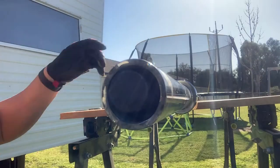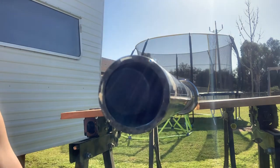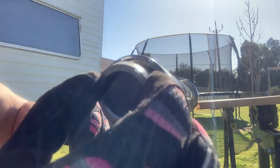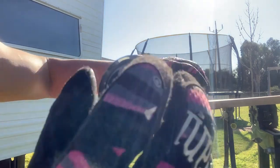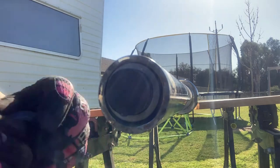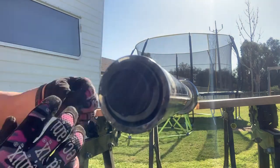Step ten: slide the sleeve back onto the bar and give it a little spin to lubricate it. The next steps are just to put everything back together in reverse order — that's why it's important to lay everything out in line. Some bars will have a shim inside between the washers; not all bars have that, but it's good to lay everything out so you know the order. Take your time, make sure everything's nice and clean, and the bar will go back together nicely.